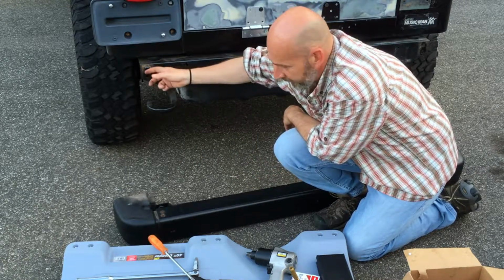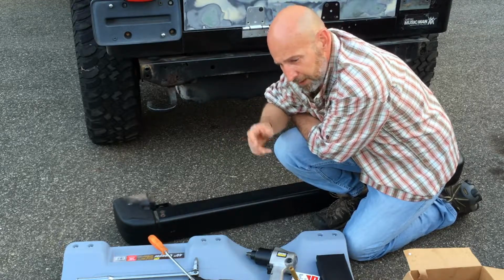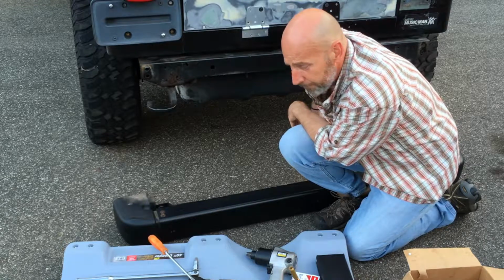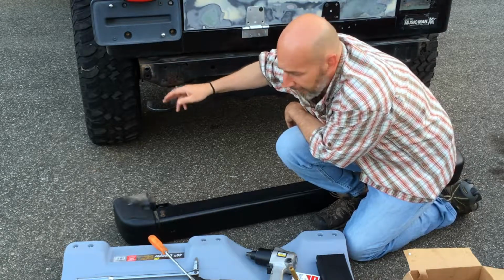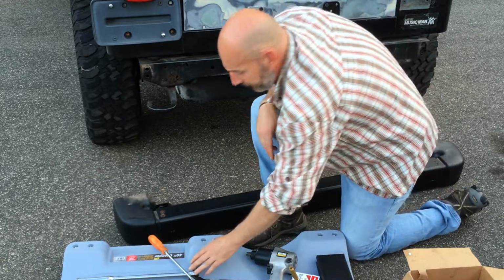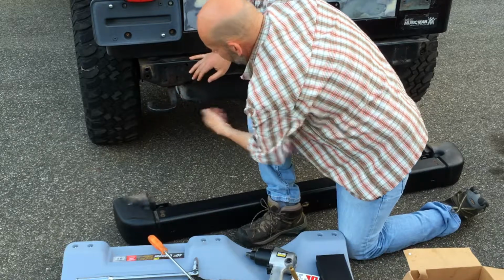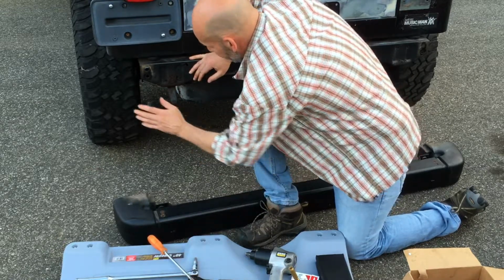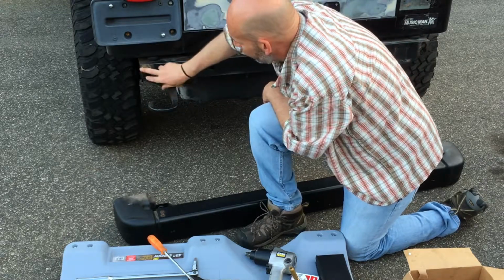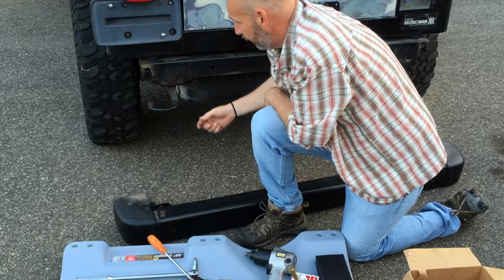and then go heat these bolts up, and then heat these bolts up, and go back and forth a little at a time. Just heat them up, and then go to the other side, heat those bolts up the same way, then come back, heat these bolts up again. And then you take your breaker bar again, and I happen to start with the two bottom ones, and I put my leverage on it, and this popped no problem, and so did those. These upper ones, you're going up on an angle, so that's a little bit harder.